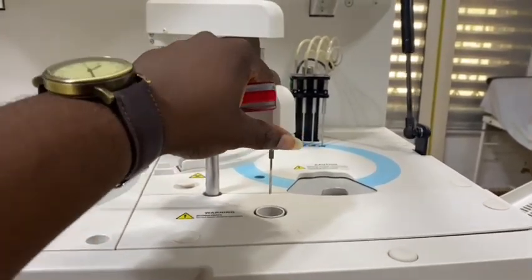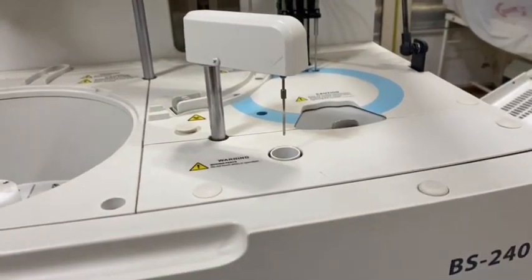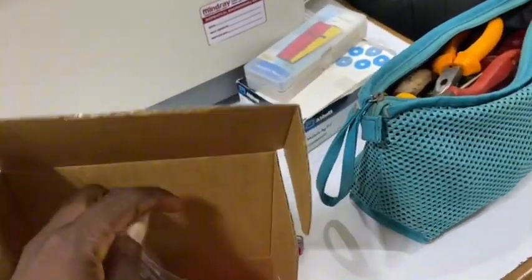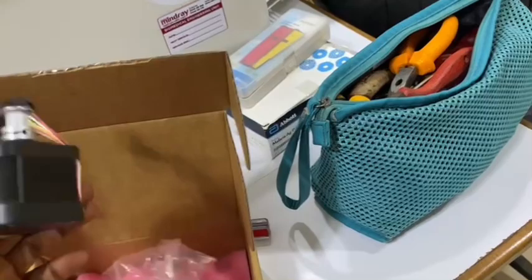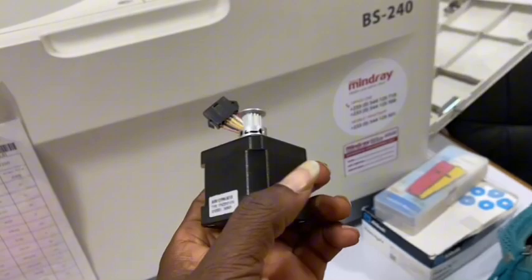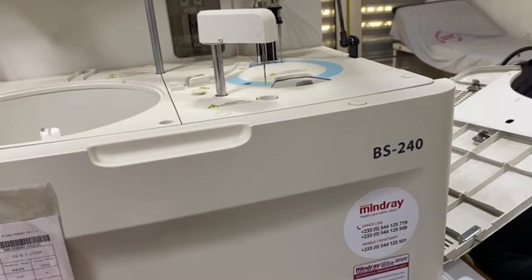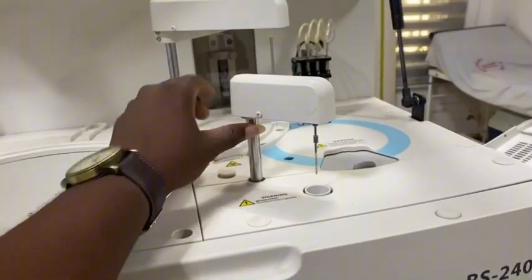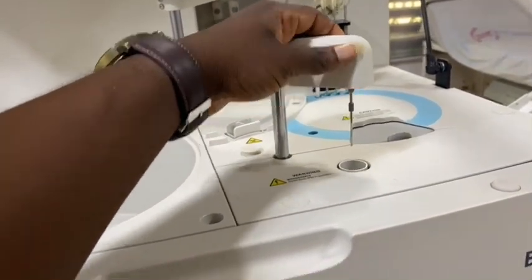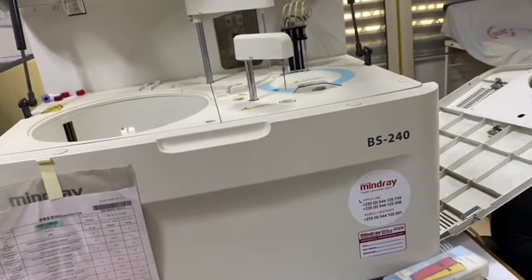I'm here to replace the motor — this is how the motor looks. The mixer has two motors: one at the top for the horizontal movement and one below for the vertical movement. As you can see right now, without even opening it, the vertical one is working fine but the horizontal one is very rigid.